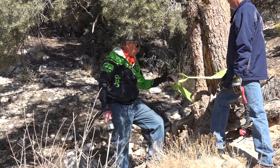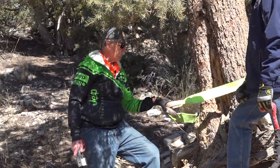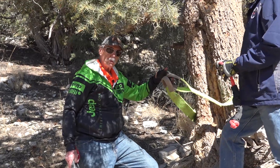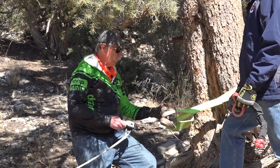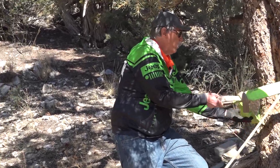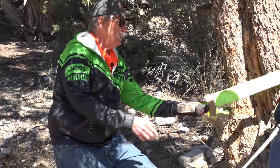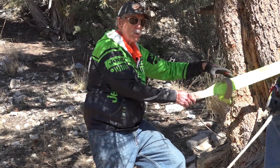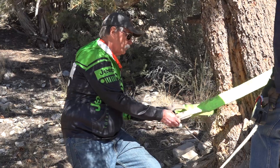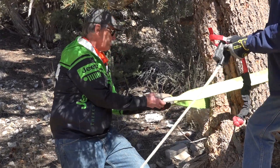So we're going to do the rigging. We've got a fairly long ARB tree saver. There are two ways we can do the rigging: we can put the soft shackle through both loops, or we can put one loop through the other. What we want to do is have it set up so that the pull is as straight towards the vehicle as possible. The disadvantage to the first method is you're putting more load all the way around the tree, which is actually not a big deal.